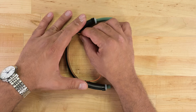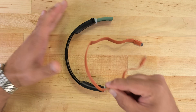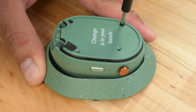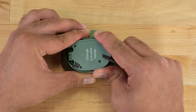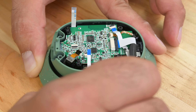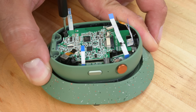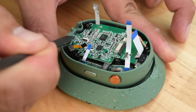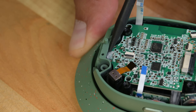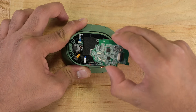And there's the USB-C cable — nothing special. Literally replace it with any other USB-C to USB-C cable. Now it's time for the driver assembly. They're easy to get into, but the components are only sold as full modules. Fairphone isn't offering replaceable PCBs or ports, but in practice the modularity of the inner components should allow for easy replacement from a donor device. The squishy stuff around the port isn't die-hard adhesive — it's easy to cut through with a spudger and could easily be replaced with a flexible, moisture-proof seal.